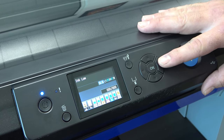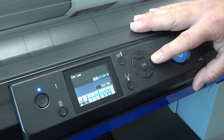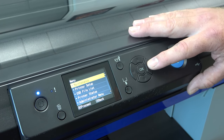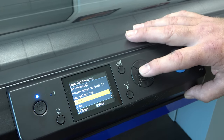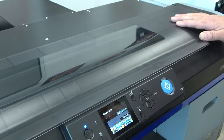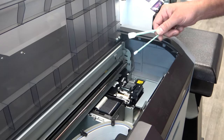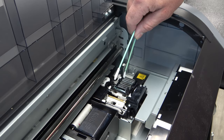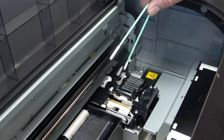The F2100 has an internal maintenance cartridge as well as a wiper unit that takes care of most of the cleaning on the machine. But once a week, Epson recommends going in and cleaning off your capping station. We're going to go to Maintenance, then scroll down to Head Cap Cleaning and perform the cleaning process. It's going to move the print head carriage out of the way and give us access to that capping station. We're going to use the provided swabs as well as the cleaning fluid to get down in here and really clean off the capping station, so we're getting good suction when the print head is capped, as well as allowing it to flow ink through those print heads and go through its automatic cleaning process.